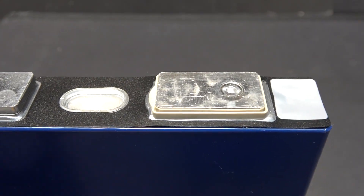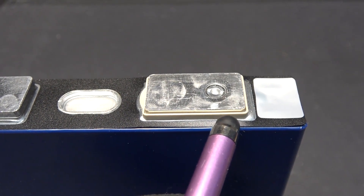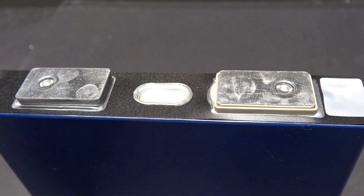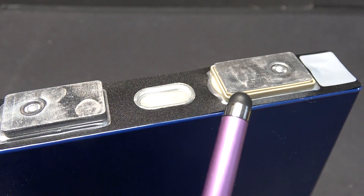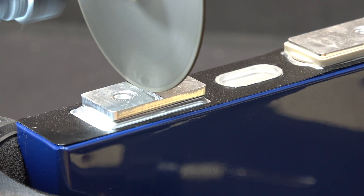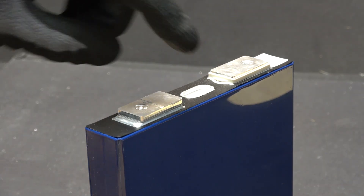We still have the aluminum bar on the negative side, but there's a piece of plastic — that's the insulation between the aluminum bar and the aluminum below it. The aluminum below is the battery case, which is also the positive terminal. So we've got the aluminum bar as the negative terminal, a thin layer of plastic insulation on the bottom, and then the battery casing which is the positive terminal. It's going to be very challenging to work on this side. The plan is to cut a groove on the aluminum bar and use a pair of pliers to pull it up 90 degrees. I'm going to use my heat gun and heat it up just enough so that when I pull it up it doesn't crack the aluminum.